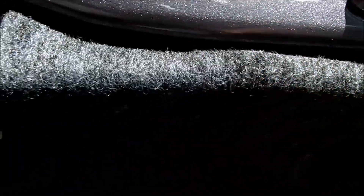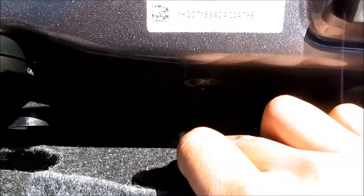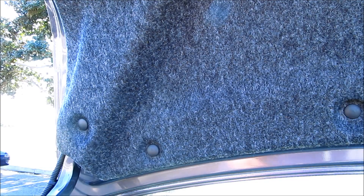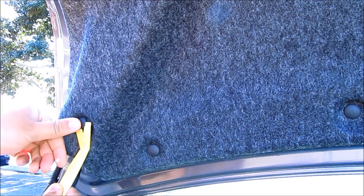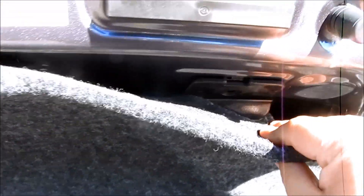It's held all around the car. The easiest way to remove it is to pull it down a little bit — you can see where the hole is. Get a pry tool like this and just wedge it in between and pull it down. I'm removing the trunk liner from this side. Get a wedge tool, wedge it in between the two, and just pry it out. Then there's a handle right here so you just push towards the back and it comes off.